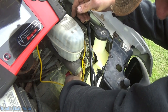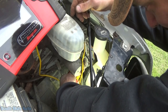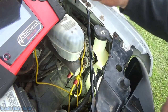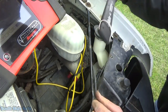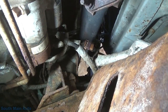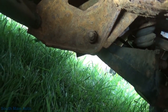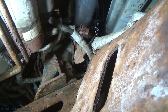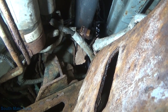Wouldn't that be something - they put two sensors in it and they're both junk? Let's make sure we've got a good connection. Yep, we've got a good connection. The crank sensors on these are a pain to get to. We're going to have to try to get to it at least to check termination there. Man, this is like some straight DIY stuff right here. I'm laying in the grass, folks, and this van is rough underneath. That is the crank sensor connector hanging there - that brown one.